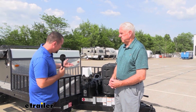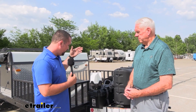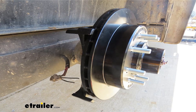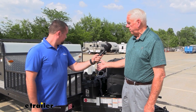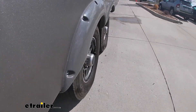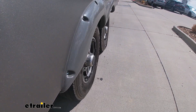Essentially, it's a pump that receives an electric signal from your seven-pole or brake controller, compresses it, and sends it through the lines to the brakes. That works for drum or disc? Mainly used with disc because of the cost — when people upgrade they go to disc — but it can also be used on a hydraulic drum. Inside is a circuit board that takes the signal from your brake controller, and with the proportional valve, your gain setting and how hard you hit the brake pedal tells it how much braking to do on the trailer.